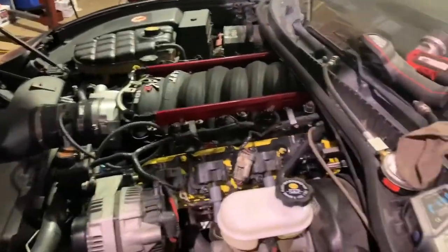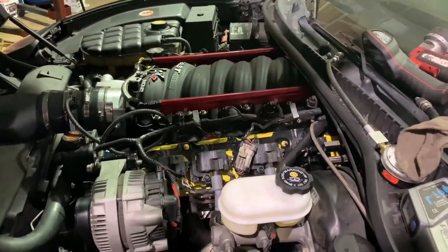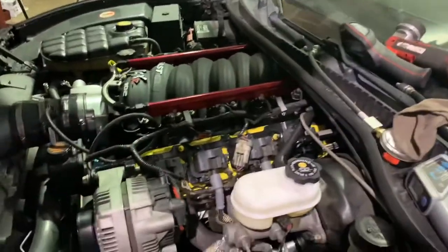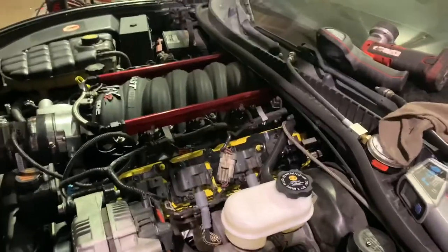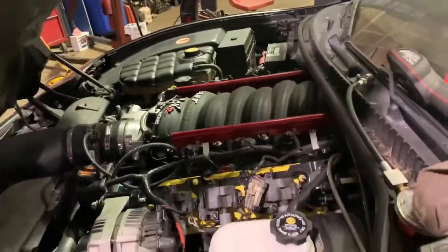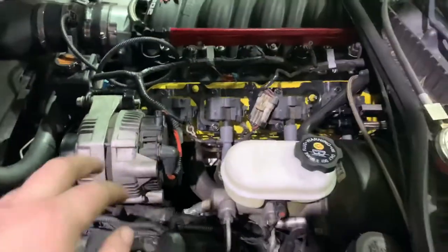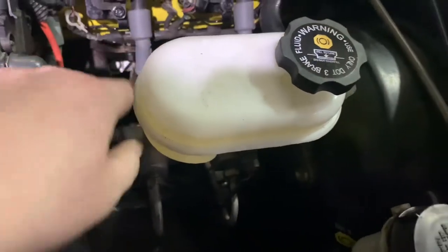So we do a little more investigating — the injectors are firing, they sound fine. The clip on this one broke, or this ground wire broke; we're going to replace it, but I plugged it in for now. Basically it was running on seven cylinders, or really five cylinders after that. At that point it definitely didn't hold any idle. But while we were messing around with it, we realized that this injector in particular — and this injector — were clogged with some kind of black shmeg. You can still kind of see the remnants of it from where we tapped it out on the master cylinder.